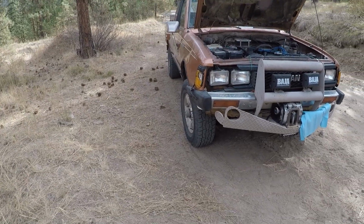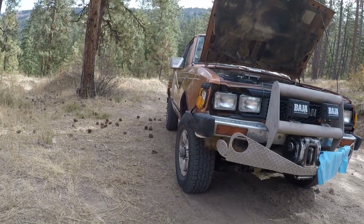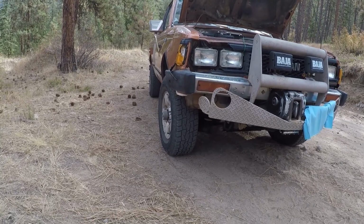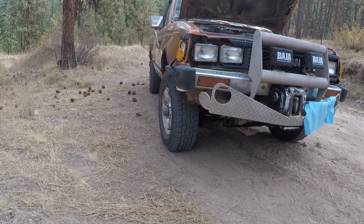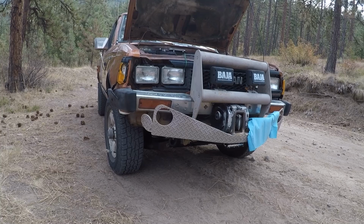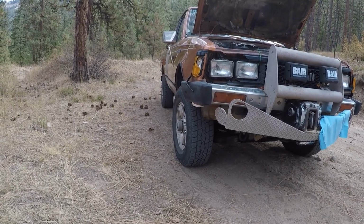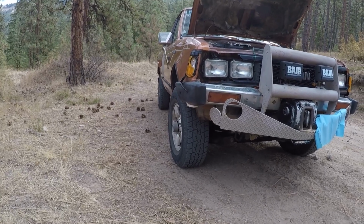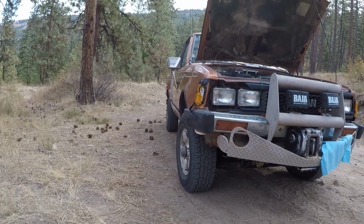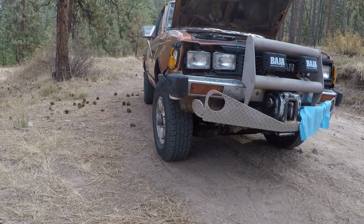I do get asked quite frequently if the truck is lifted. I have not lifted the truck at all. It just barely clears the 235/75/15s. So if it has been lifted ever by a previous owner or something with just a slight torsion bar adjustment, the front bumper pretty much brings it back down if it has been lifted. So it's factory ride height, and I've compared it to others, and it's basically factory ride height aside from a tiny increase from the tire size. So I have not lifted this truck, and it doesn't drive, look, or feel lifted.